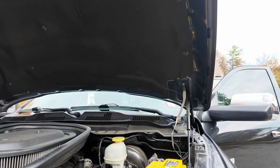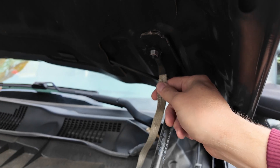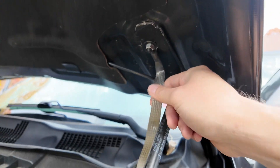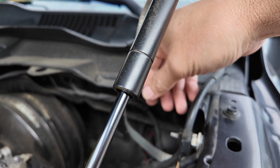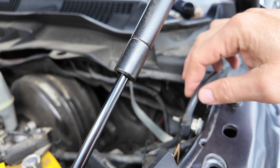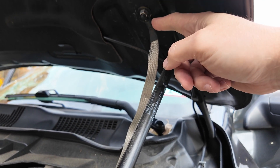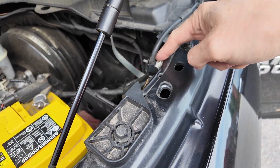Now underneath the hood here, you'll see that from the hood latch and the hood itself I've got a long strap that goes down and bonds to this grounding screw which is already tied into the electrical here. So now I've got an electrical bond from up here in the hood to down here to the actual ground in the truck itself.